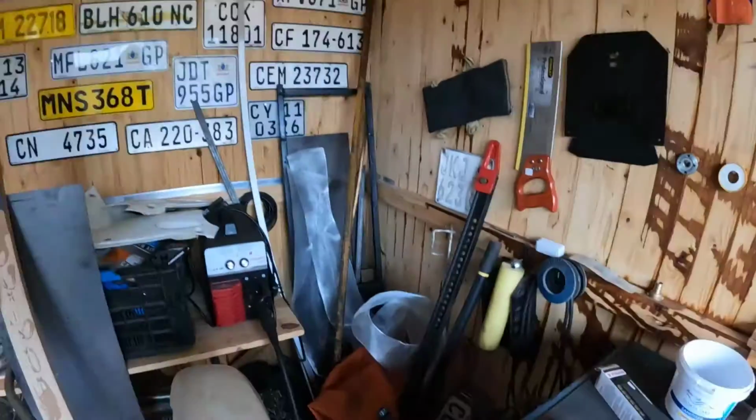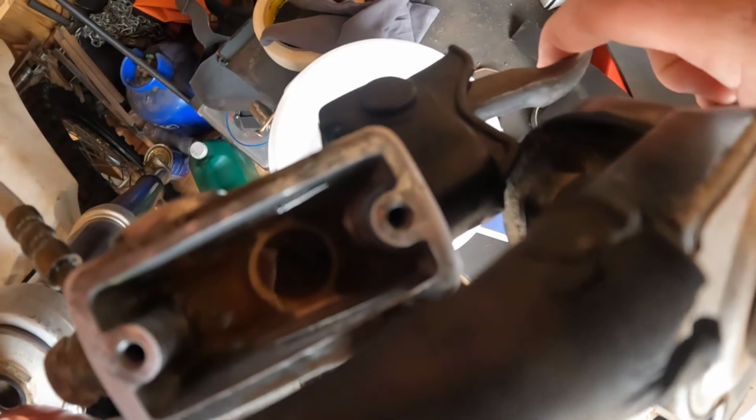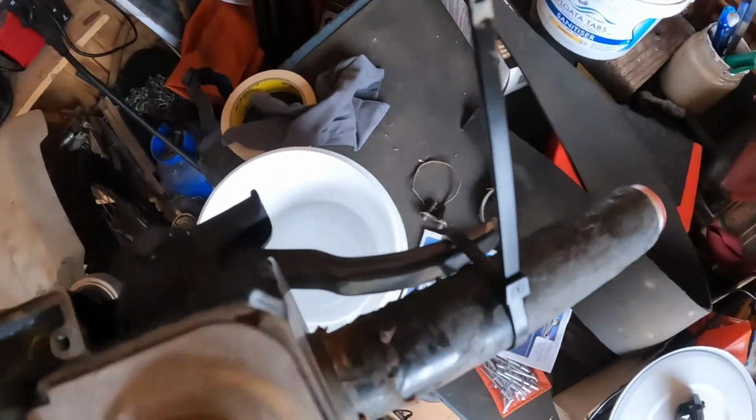Okay, let's see if we can get more air out. I think the level actually raised now. Okay, no air bubbles this time. I'm just gonna clamp it down, open it up, so if anything squeezes out, it can release itself. I've clamped down the lever, the reservoir's full, and let's see if we can squeeze out some more from the bottom up.